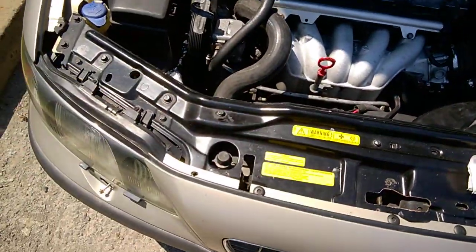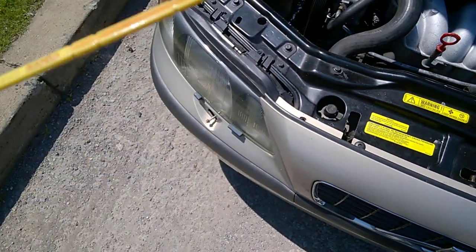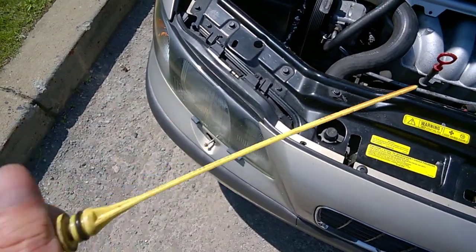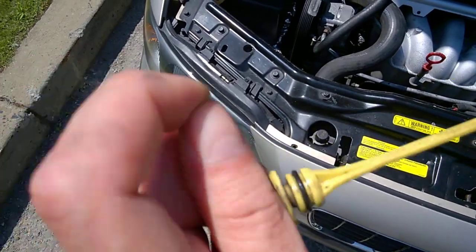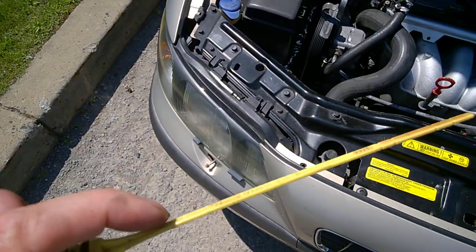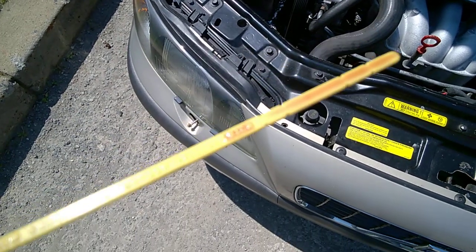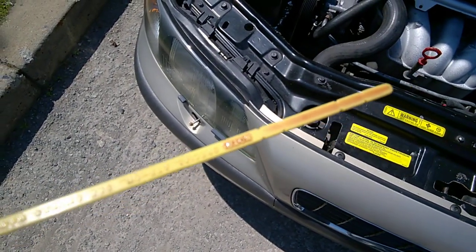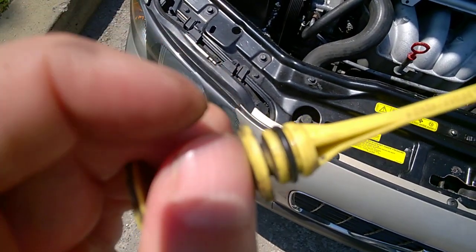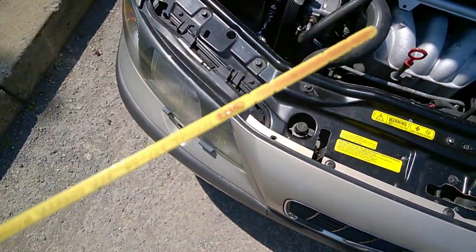Let's have a read on this. It's good to check both sides. When you pull the dipstick from the tube, the tube has some fluid on it and that fluid may get all over the dipstick. So look for some place at the top where the fluid seems a little bit thicker — that's the key word here: look for thicker fluid, not just a smear. Sometimes you may see a droplet or something. Look on both sides.